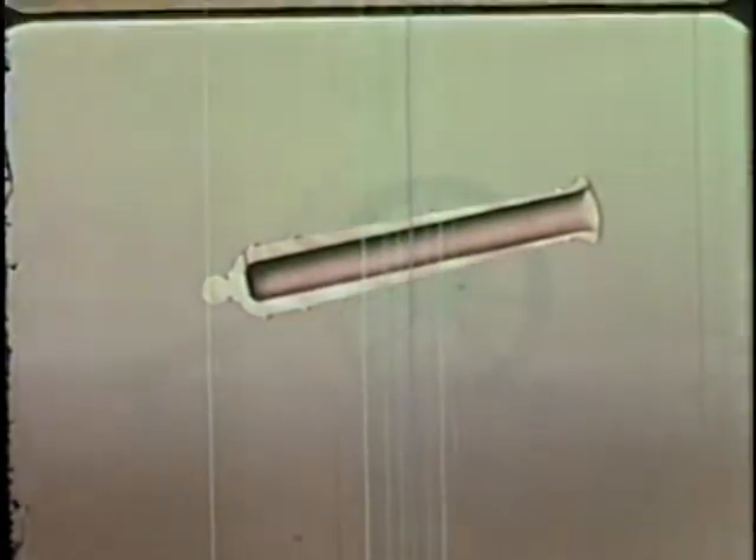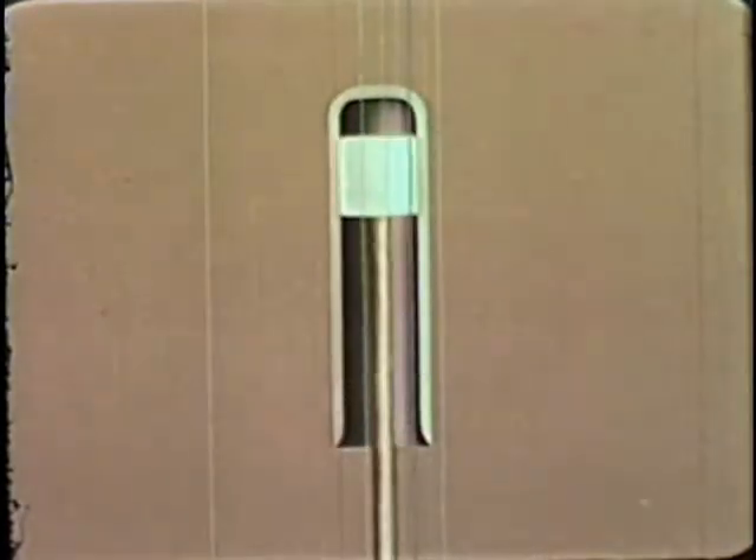The analogy can be carried further by changing the cannon barrel into an accurately machined cylinder. The ramrod becomes a piston that slides up and down in the cylinder. To make the piston fit the cylinder accurately enough to form a seal, rings are set in grooves around the piston.